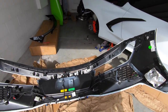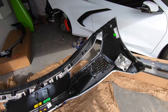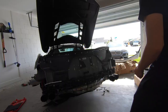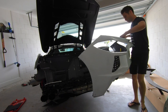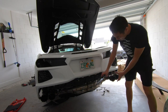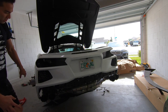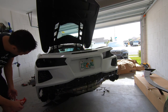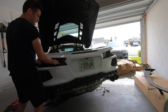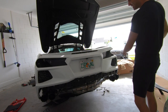We've got a smaller, more manageable piece now. With all the curves this car has, it's going to be so much easier with less surface area. And since everything is pretty much off, trimming the wrap will be easy. I'll place the rear bumper back on the car — it'll be a lot easier to work with. Without the tail lights, spoiler, and bottom piece, you can see exactly what we need to wrap. The only tricky part will be around the areas I couldn't remove — we'll have to take extra care trimming there.